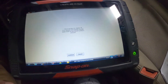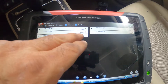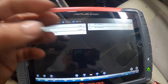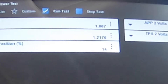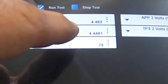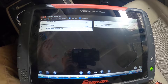I'm going to do a throttle flow test. We're going to follow the directions. This is your throttle position sensor, TPS — these are your volts. We're going to hit run test. Right now you're sitting at 0.89 volts. When I give it the gas, the volts should increase to like 4 or 4.5 volts. I'm doing a slow press of the acceleration and it's going up slowly. See how smooth it went up all the way? There were no spikes up or down — it went nice and smooth. If I release it, it's going down just as smooth as it went up.